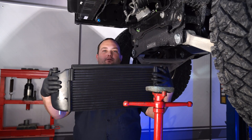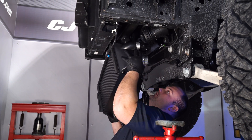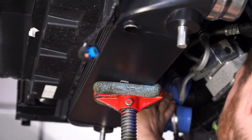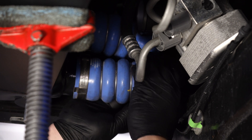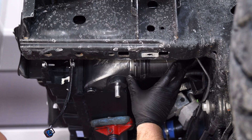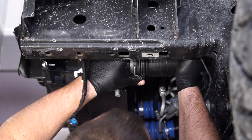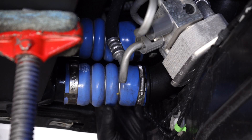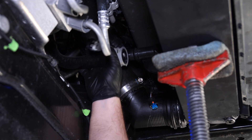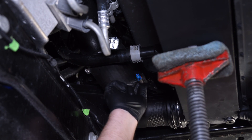Make sure you have the rubber grommets on top of the intercooler, then you can put it into place. Get your couplers installed, then rotate your clamps to where they're easy to get to. Push the cold-side intercooler pipe towards the intercooler until the spring snaps into its groove. With the couplers on, tighten the clamps. Reconnect the bypass valve hose and also the connector for the bypass valve.